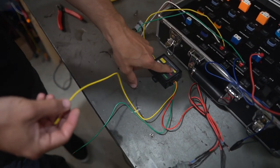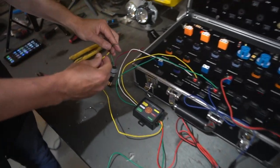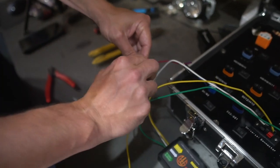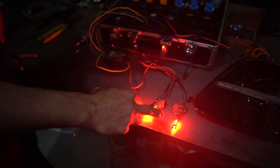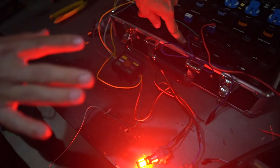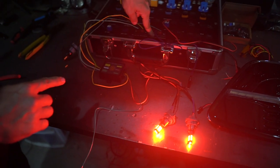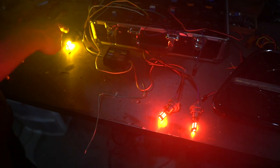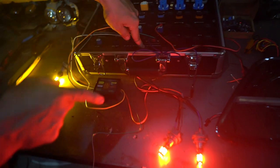The yellow output wire says left. I have a bulb here that's already got ground connected — I'm just going to connect the voltage wire to the module here and test it. There we go. We give it power, it fires up. That thing is super bright. Now if we test again, we've got our brake lights, but then if I'm on the brakes and I hit the left turn signal, I'm able to do that. It's actually lighting that thing up when it doesn't have power from the circuit it normally does.